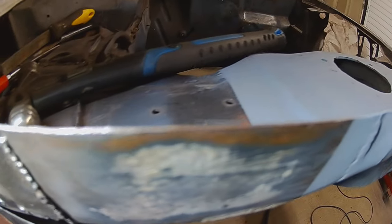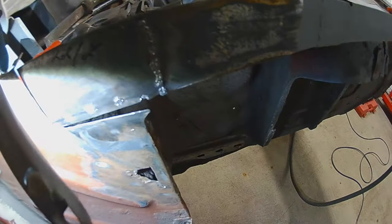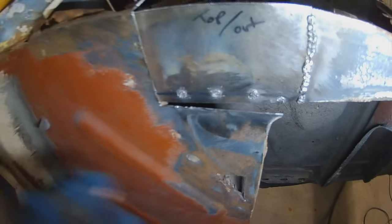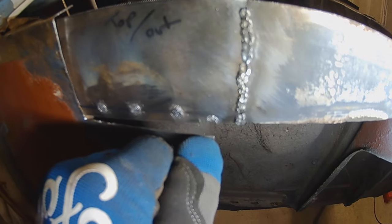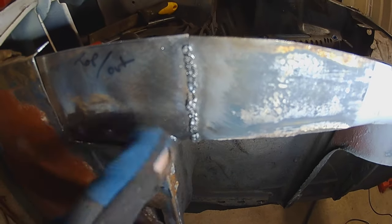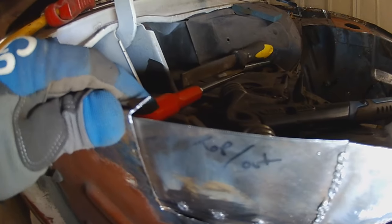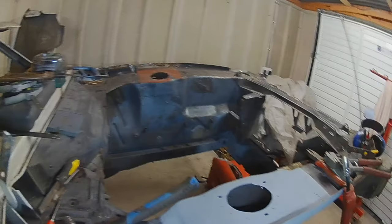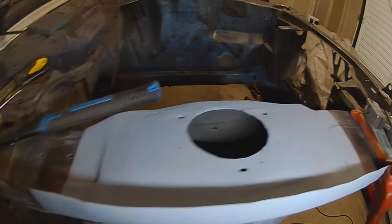So that becomes now the one single piece that runs behind there. The next thing to do is the third piece, which is this outer piece - it now needs a bit that goes up to there. I've actually left that as a last point - just up there, across there. That was originally spot welded on but we'll seam weld that little piece there. It literally just pushes back in place and the wing rail sits on top of that. The wing rail will probably be the next video - if not, the next video will be Mike's video repairing that side. So the next video might be the wing rail.